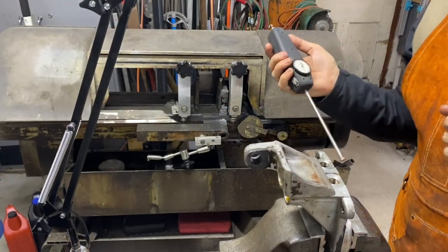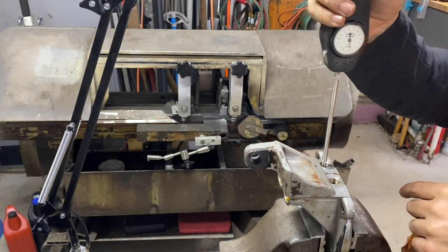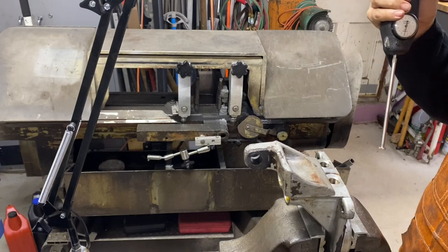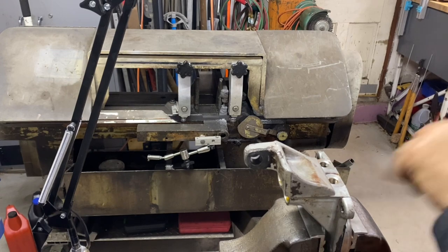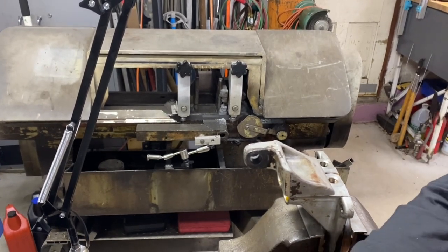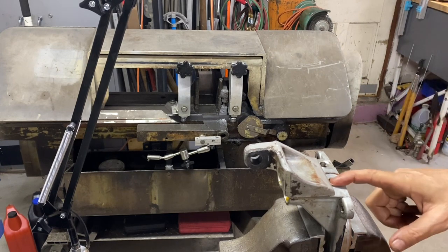With the push gauge on the front axle — the one that worked better — I'm getting about 20 pounds on the weaker side and 30 pounds on the stronger side. The spring is getting preloaded more because it's sticking up higher for the front axle. So I need to extend the length of the spring. The real problem is there's not enough preload on this spring.